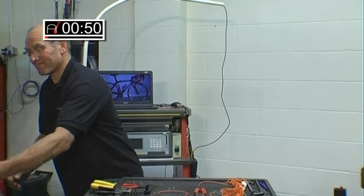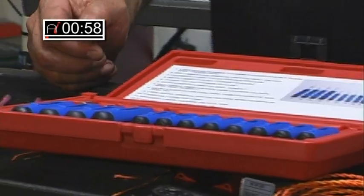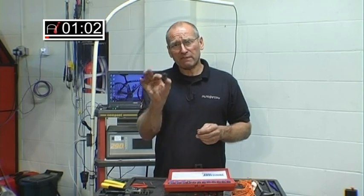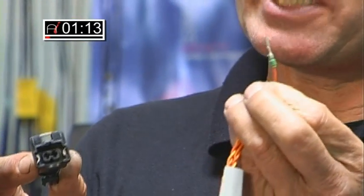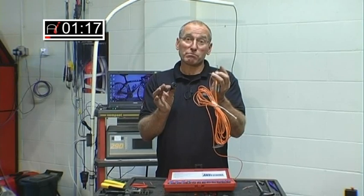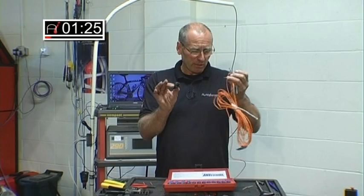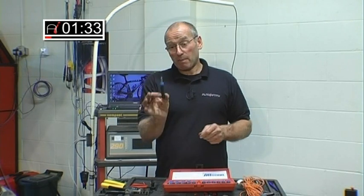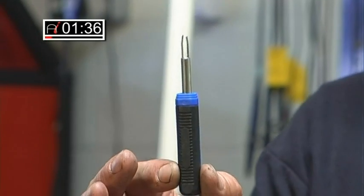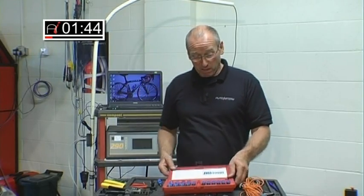First of all, the tools. Tools such as these allow and enable manufacturer's sockets, and they come in all various sizes, types, and variants with some very discreet fittings. The size of terminations is such that the correct tools are absolutely vital — if you're going to remove the pin from the socket, and more importantly, if you're going to put the pin back in without damage to the new pin. So it's absolutely vital that the correct extraction tools are used. The particular tool I'm going to use in this exercise has jaws that are precisely manufactured to allow correct insertion and removal. That's the first important part of this presentation.